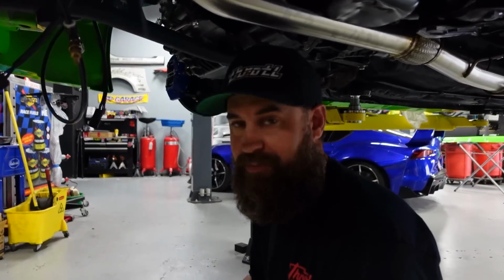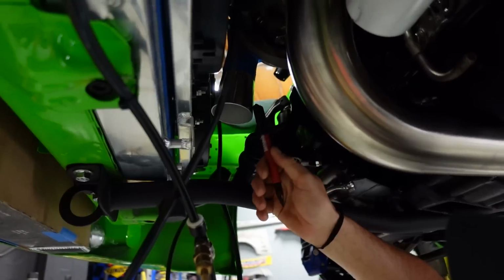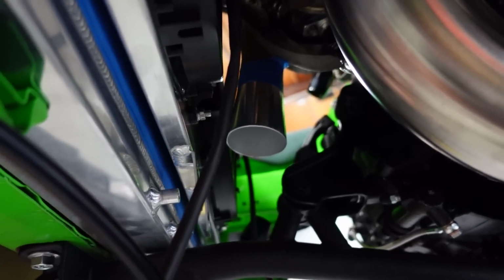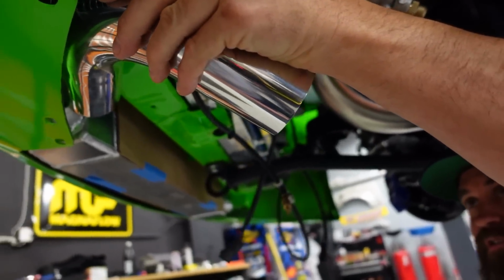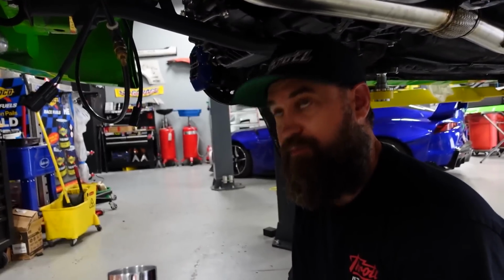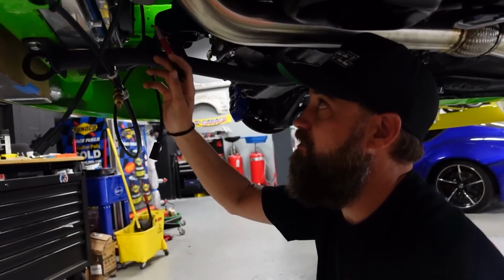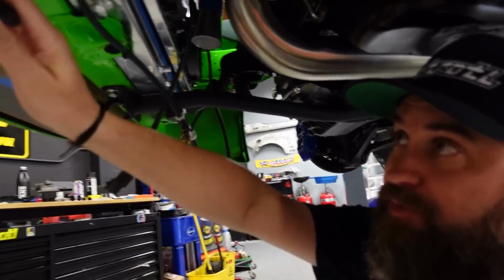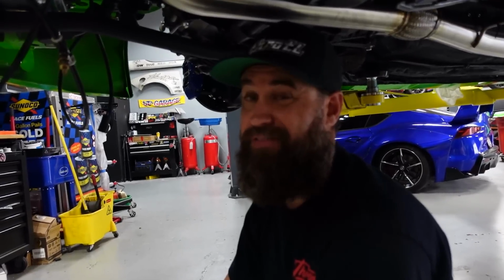What's happening here is I'm hijacking Quinn's project because I like doing the fun fab work. So we basically have our turbo neck right here. We've ordered a conical aluminum reducer, which is gonna get us up to 2.5, which is what our intercooler is. We're gonna basically just start creating the intercooler piping flow. We've got our Mishimoto quick disconnect clamps that are gonna go in this process. There's gonna be one right here and one right here. It's gonna allow us to easily drop this pipe out. We may even put one in the center of that, so it's a 2-piece.